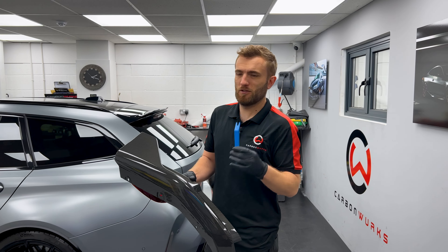The car's up on the lift — feeling brave, you might actually be able to do this on the floor, but I've got a lift so I'm going to use it. I'm also going to try and one-take it, so fingers crossed. First things first, trim tool underneath — there's a series of four trim clips that just need to be removed. Standard pull the pin to remove the center, and once that's released the tabs you should be able to pull the whole mushroom clip trim clip out — three and four.